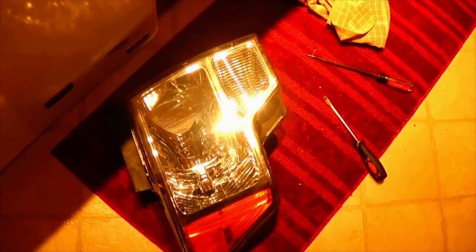I took OEM headlights — I bought these used, they're regular ones, not aftermarket, so they're perma-sealed. The best way to open them is to bake the headlight so it softens up and you can pry them apart. You can also use a heat gun, which works pretty good too, but I prefer baking — it makes the whole thing hot and makes the part easier to open. I'm using a screwdriver, but you can also use a putty knife, either skinny or wide.